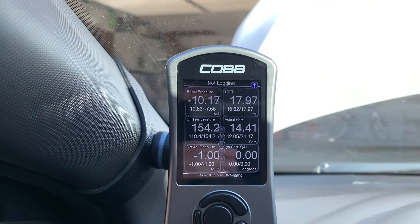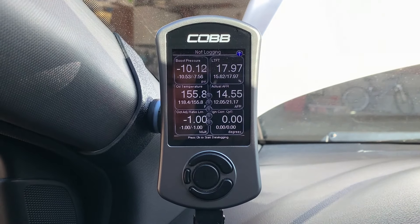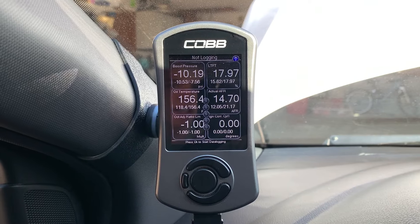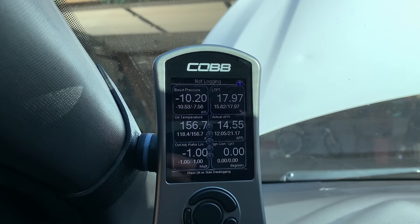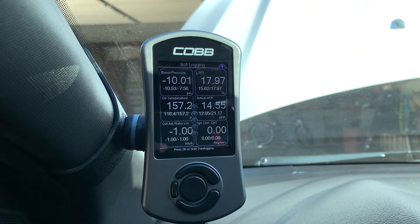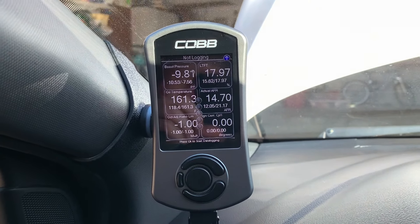There are other things you can monitor like air temps. Some people like to monitor misfire count on different cylinders — I don't monitor that because it can make you worry when it's not usually a big deal. It is normal for these engines to misfire at idle; the misfire count can get to a seemingly high number but that's not usually an issue unless you can tell the car is running rough while driving. It would also be good to monitor knock count if that's an issue with your car — it's pretty much car-specific.